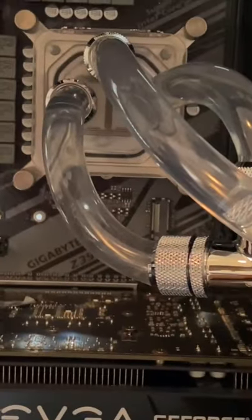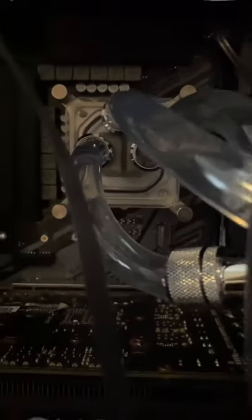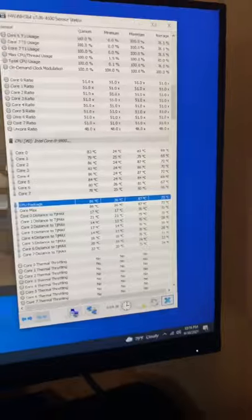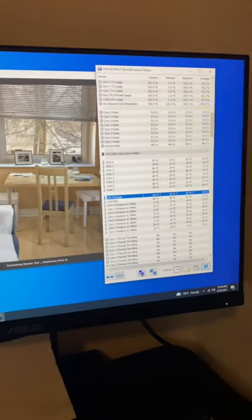Let's see if we can run this again next round and get lower temperatures after I get the air bubble out. So I got the air bubble to move to a higher point in the water cooling system. I'm running Cinebench again. Let's go ahead and check our temps. 87 degrees C, so it's about 1 degree C lower than last time.